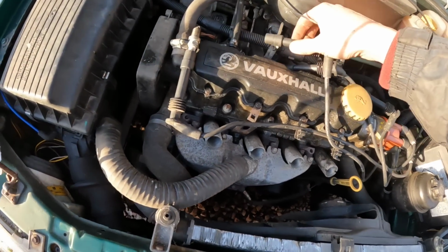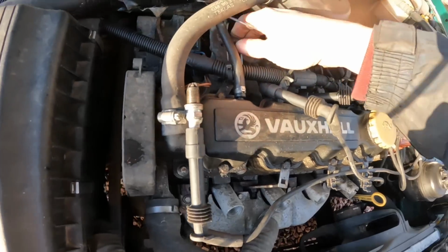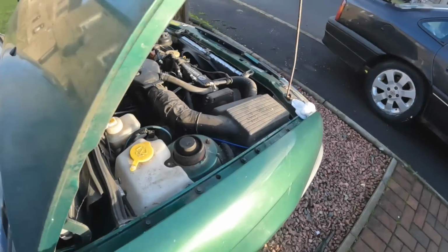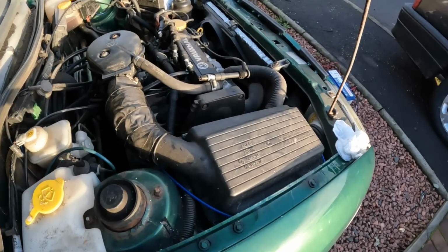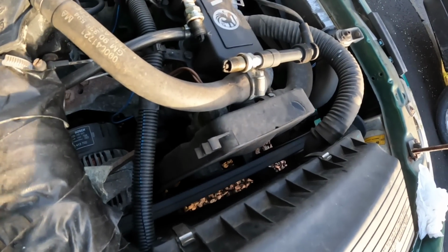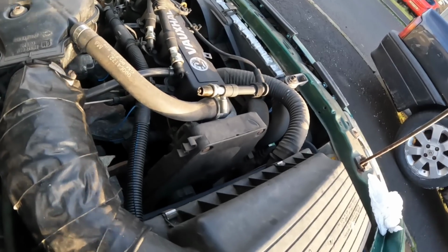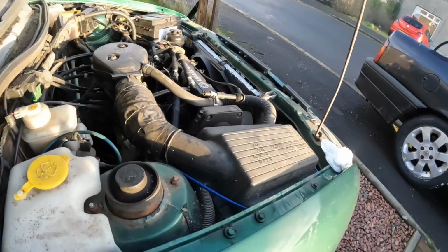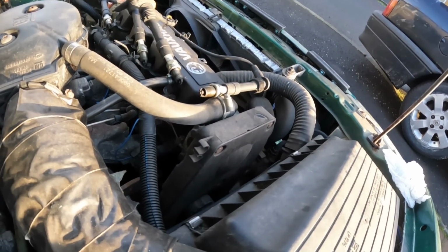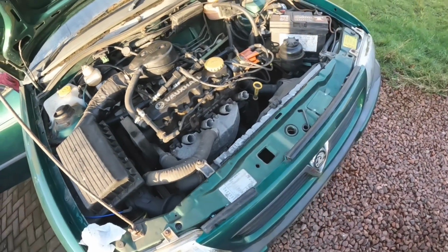I think it will have now. Oh, dropped the plug down there. I think it will spark and fire now. I think those terminals were corroded with it sitting. Let's see if we get any sort of spark off it. Interesting. Don't think we're getting a wonderful spark, but yep, they are sparking. Right, okay, let's put the plugs back in it, see if it'll fire.